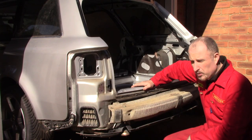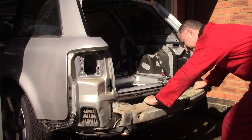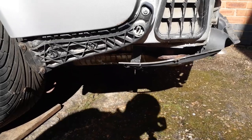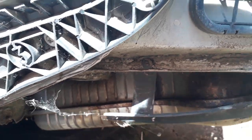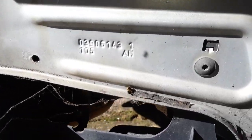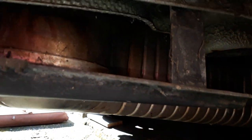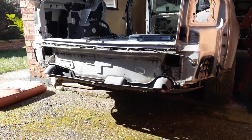With the outer plastic skin removed I can now remove the metalwork. There's a series of screws — there's one up in there, and then it follows the car around with this lower plastic trim. There's another screw there, and another one in there, and in the same position but on the opposite side, just in there. I'm going to undo all those screws and remove that lower plastic trim.